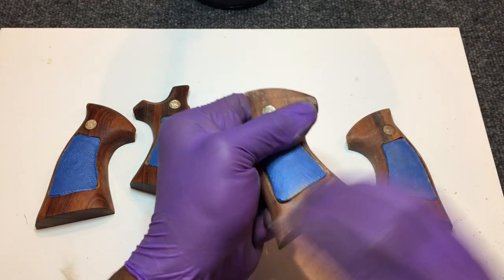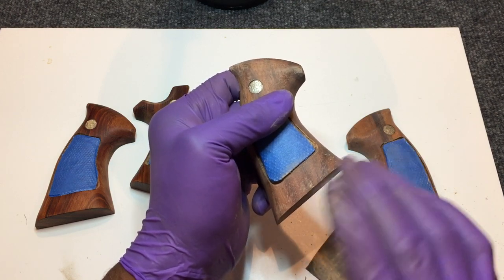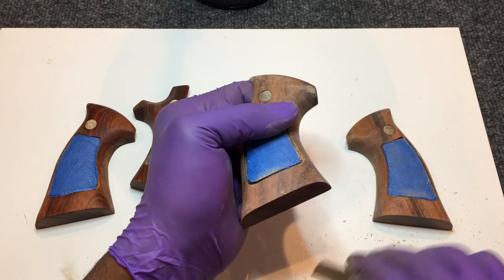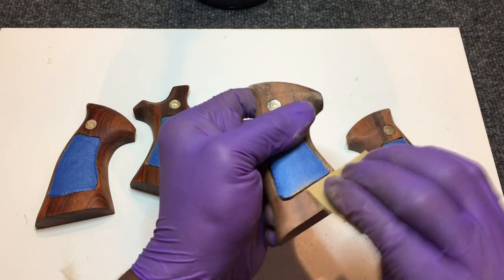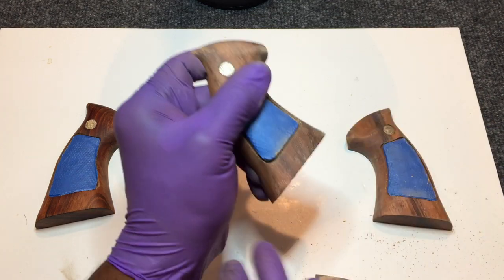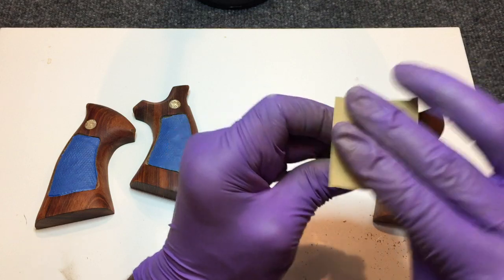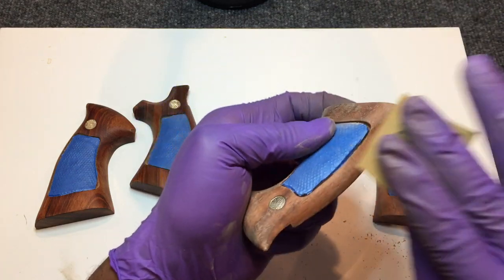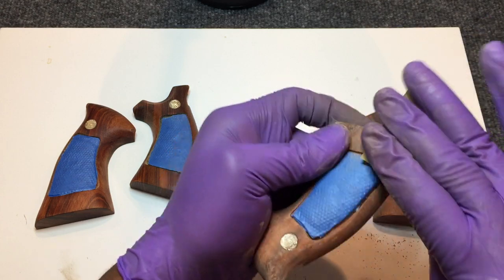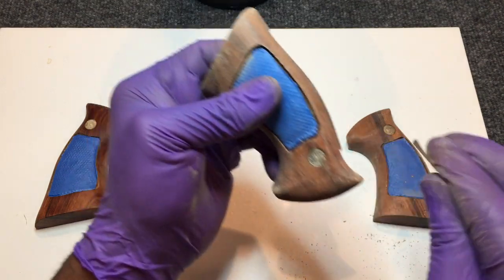What I'm going to do is just keep sanding over it until I smooth it down a little. And I'm doing that with the 1000 grit rather than the 500 grit because the 500 grit may remove a lot more of the material on the low side of the high spot. So I just want to smooth down the high spot so you don't see it or feel it as easily. And at the same time, it smooths the panel extremely well for the new finish. All right, that feels great. Just dust that lightly. Get the back strap. This is 1000 grit, so like I said, it's not going to change anything. It's just smoothing out the 500 grit sanding lines.